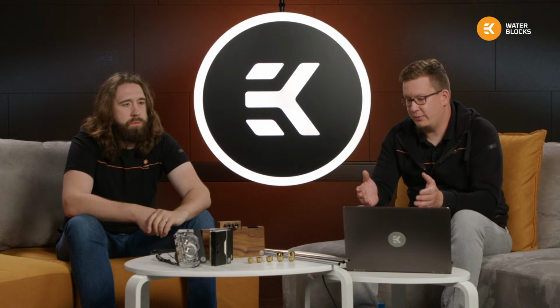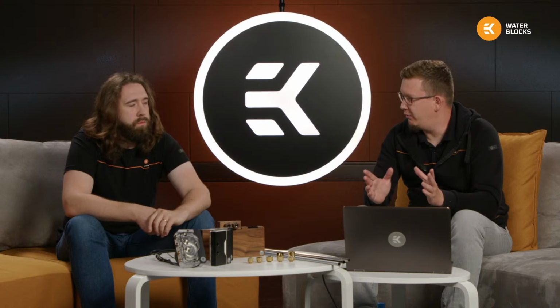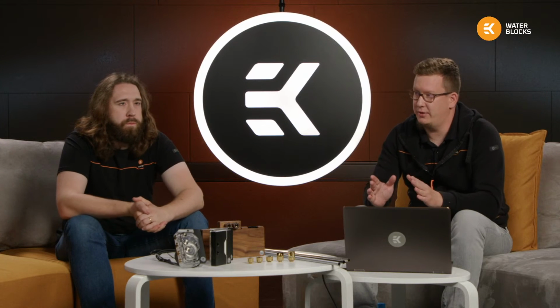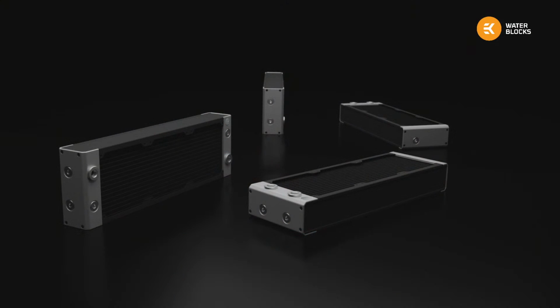What can we say about the 120 versus the 140 size of the radiators? Which are the key things which will be the same on these products? So the key thing which will be the same across every single radiator now is the position of the ports. So no matter which distro plate you have, it will be compatible with every size of radiator. Unlike right now, we have to prescribe, okay, the P fits there at the top in that case, and the X fits at the bottom, and this will be far more open. And also, because the 120s and the 140s have the same spacing, that also means you have some more freedom to swap while still having really nice or even directly mated tubing to the distro plate.